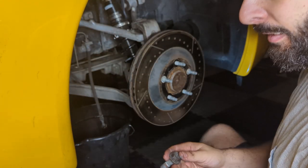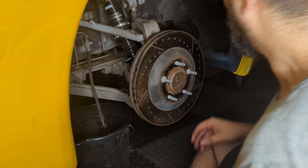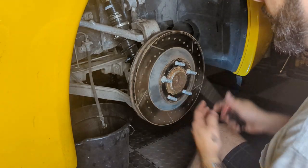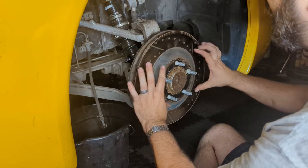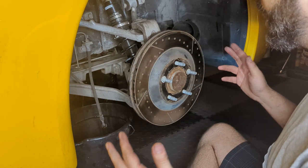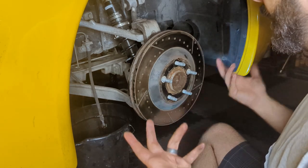All the hardware — like I said, Willwood sent new hardware, which is outstanding. All you've got to do now is take off these two little clips right here — they just pop off. And then I'm going to clean the hell out of this rotor. I'm going to tape it off and paint it with some high-temp paint like the other three wheels I've already done. Then we'll go to the other side and I'll show you the install process for the Willwood brake.